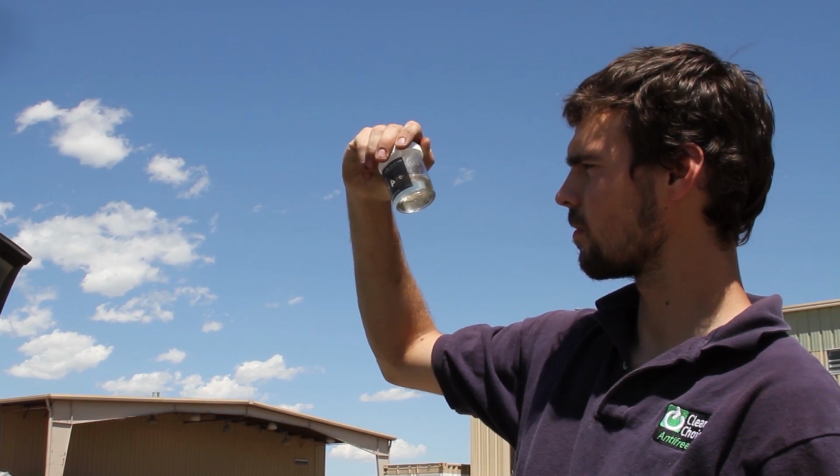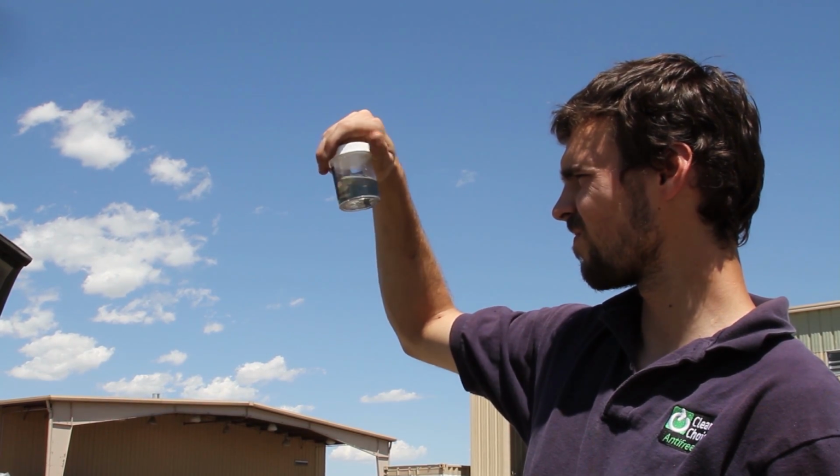The second part of our test is clarity, which could well be the single most important indicator of the condition of the antifreeze in that vehicle. Simply stated, a clear coolant indicates no corrosion or any chemical incompatibility. On the other hand, a cloudy appearance or floaters or sinkers in the sample indicates there is a problem and this coolant should be exchanged.